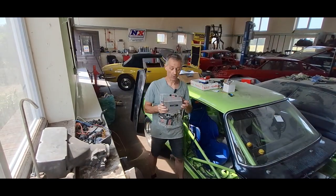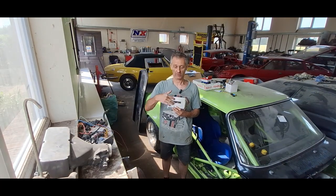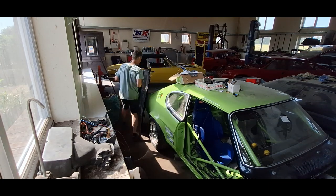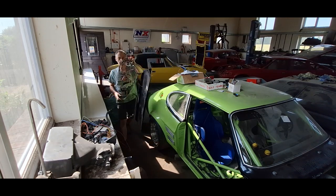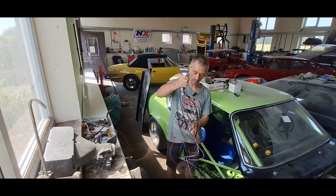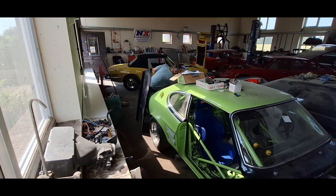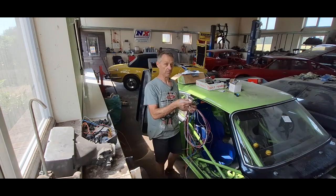I've ordered the ECU. It comes with the ECU, obviously, with the guy's label on it. It's got two part plugs on the end — these are where the wiring loom goes to. The version I bought has these two plugs on: one is for the main wiring, as you can see — there's a lot of that. The other plug has the spark controls in it.